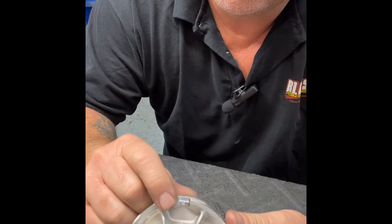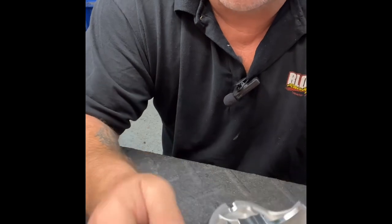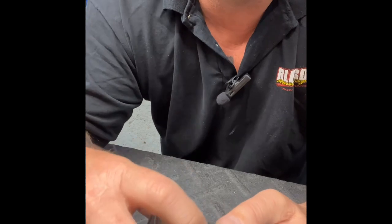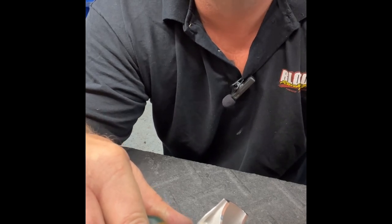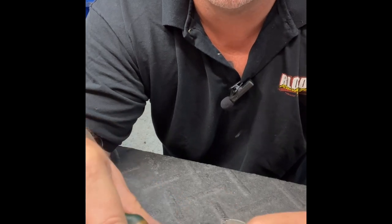To get it to seat. And then, when you come back over to the other side, the wrist pin will be there and you're not going to have the room in there to grab a hold of the single wire like that and shove it in because it's going to hit the wrist pin, and you won't be able to shove it down inside vertically. So this one is a little bit trickier.